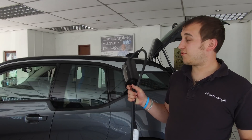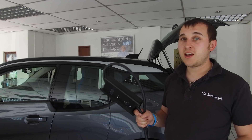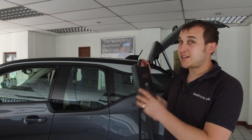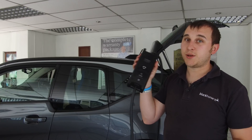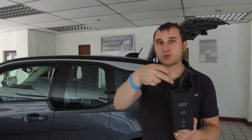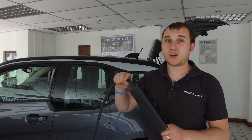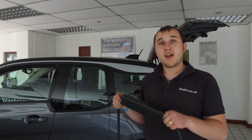You could argue you might want some of these benefits. Even if you haven't bought the granny version, it has DC leakage protection, which is a requirement on all new granny cables that are manufactured. Because this uses the same box across all versions, DC leakage protection is built in. What I wish they had done is make this a modular system — a little box with a peripheral port, like what Tesla give you, so you could swap the cable out to a granny cable, Commando socket, and various others, giving you a really versatile charging system. Sadly, they haven't done that.